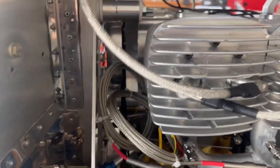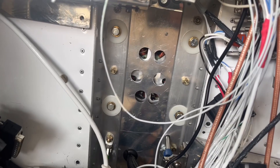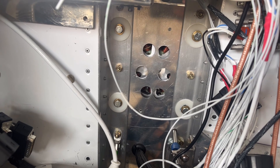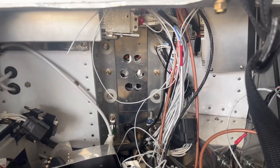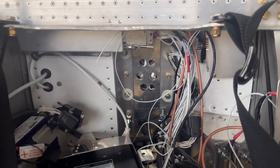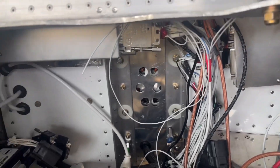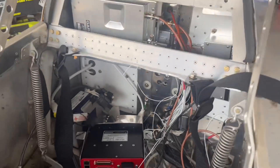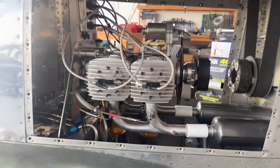I've got my work cut out for me to shave these spacers down a little bit. That spacing for the generator cooling is looking good - I've got the holes drilled on this side. Then I have to build a little box there and figure out how to plumb the air up into it. It'll probably come from a little hole down in the pan right there that sits above the gear. I'll make sure it doesn't interfere with the rest of the wiring and cables, and it'll keep the engine area isolated from the pilot area so I don't have to deal with potential fumes.